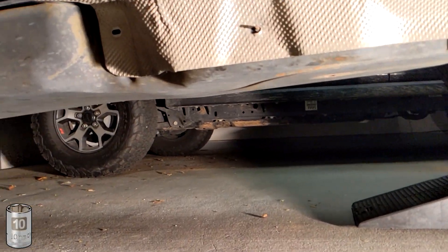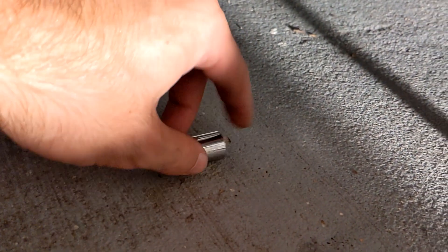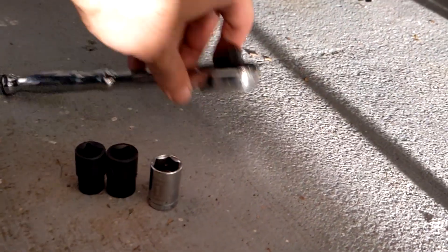Make sure you have all your tools together and get under the car. The first step is to remove the heat shield. There are two bolts and two nut washers — both are 10 millimeter. Once removed, place it aside. The front CV joint requires the E12 socket to break loose. These bolts are at medium torque and aren't too difficult to remove. None of the bolts should really require an extension, but see what happens.